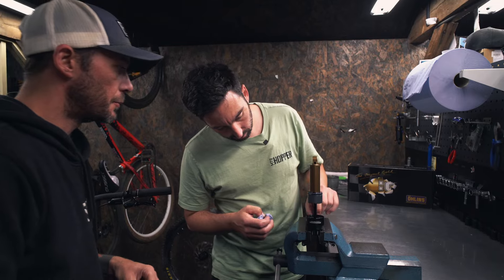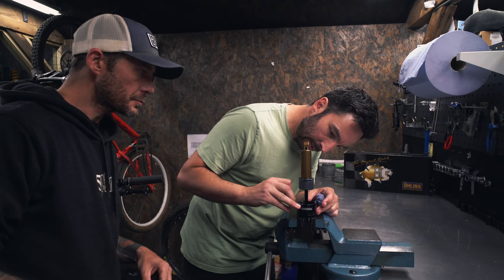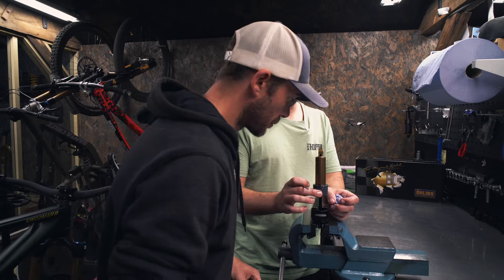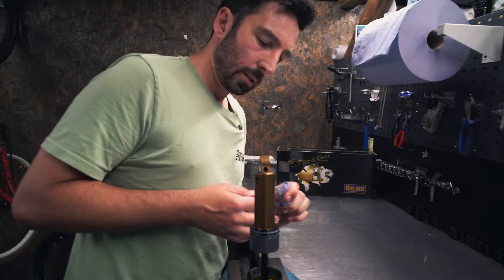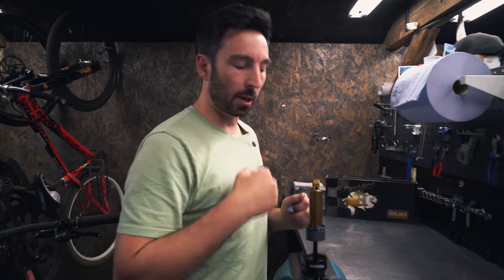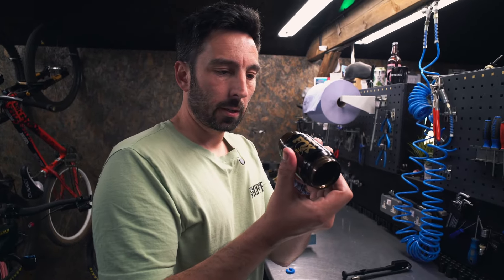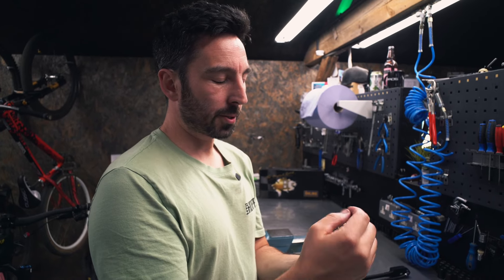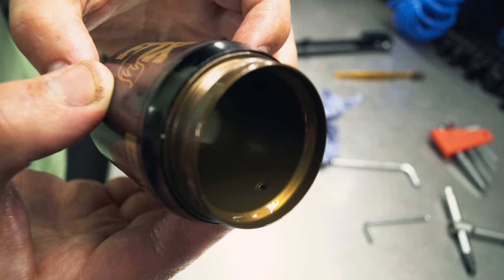It looks like that just smashes into this O-ring here - there's a little O-ring in the end. It's big, so it literally just goes up against the surface of the shock and reduces the volume. Let's put it on the dyno and mash it up and down to see what it's doing. The inside of the air can looks pretty standard - there are some air swap bumps, or bypass bumps as they call them - little indents that allow positive air to swap into the negative air. And then there's a hole at the end that provides this bigger air can with more volume, which increases the overall volume of the shock.